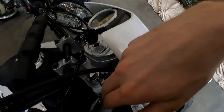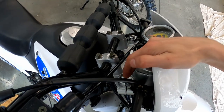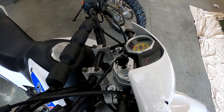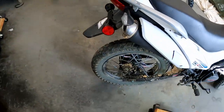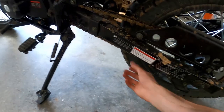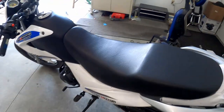I got the fork fluid all filled up and then got the caps and drain plugs all reinstalled. The caps were a bit difficult to get started thread-wise because of the spring preload, so I pushed them down a little bit, made sure they were centered so they wouldn't cross-thread, then started them with my impact driver and finished them off with the ratchet. I also tightened up my chain because it was crazy loose — the spec is 10 to 20 millimeters of free play; I've got about 13 millimeters now so that should be all right. Put my battery back in and now it should be ready to go.